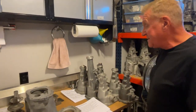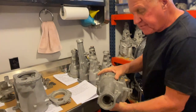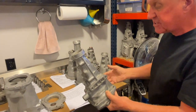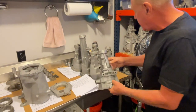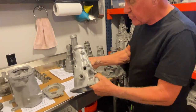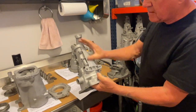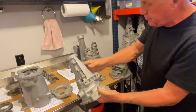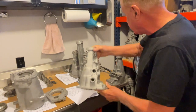The last thing in this lightning event is tail housings. The 731 tail housing is for '63s only — it's identified because it has what I call a fin on the bottom. Starting in '64, they came out with a 429 tail housing. The early 429s also had the fin, but later 429s have a plate on the bottom instead. I think what was happening is people were jacking cars up on the fin and breaking them, so they put a plate there — it's still not a good place to jack, but I think GM did that in defense.